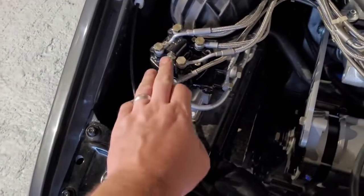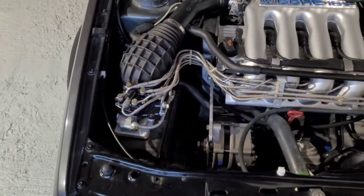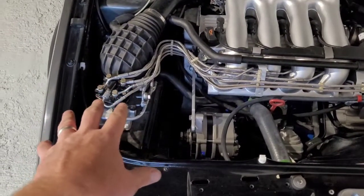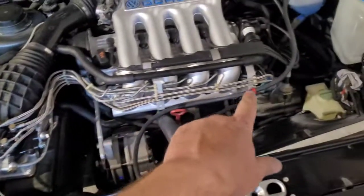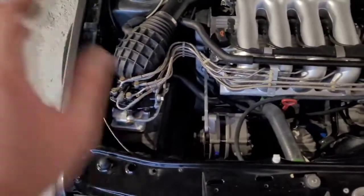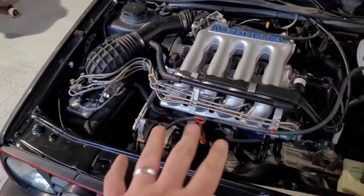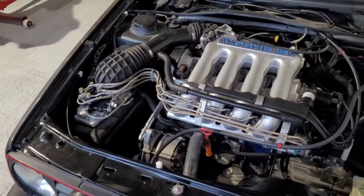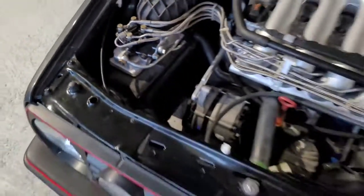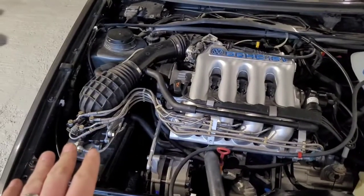So once the other bits turn up, we can take that off, mock our kit up here with the gauge and stuff. And then once we know we've got fuel pressure coming in, there's no leaks at the back end, there's no leaks down here, we can then start double checking the fuel pressure, main supply pressure or control pressure, and then the warm-up regulator will need to be adjusted relevant to that pressure, but I can only do that when it's warm. So once the gauge is on and I'm happy we've got the main supply pressure, I can pull the injectors out, make a kit for that, get the injectors flowing through the fuel, making sure they're all even. Once they're all even, I can then pop those screws back in there, get them all tightened down, torqued up, touch a bit of paint maybe if I need to, if it chips off.